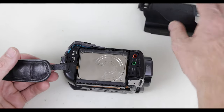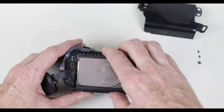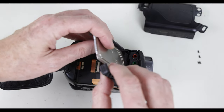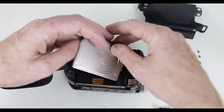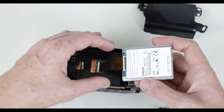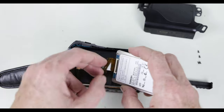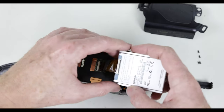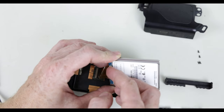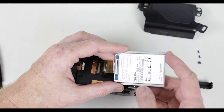As you can see, there's the hard drive right there. It's got rubber bumpers to help insulate it in case it falls. You can pull those bumpers off — we'll reuse those on the new hard drive. As you flip the hard drive over, you will notice where the ribbon cable enters the hard drive there's a little black tab right there. That little black tab flips up and then the cable will pull free.